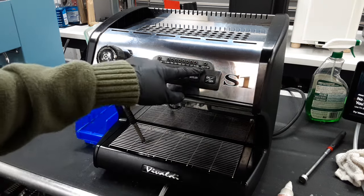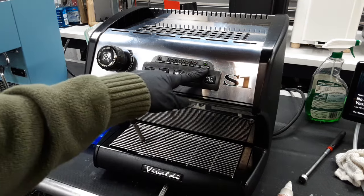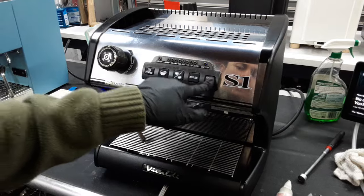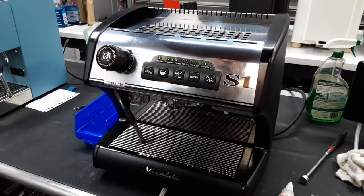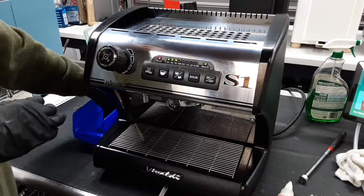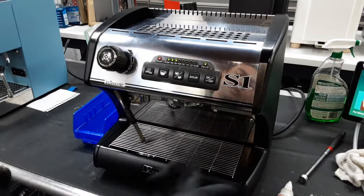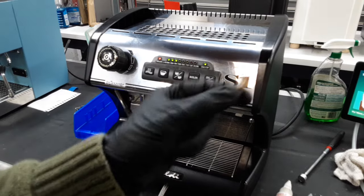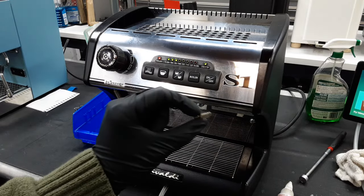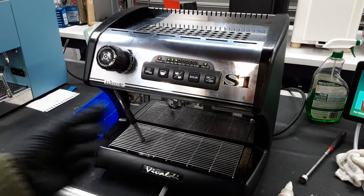This light wasn't flashing at all — indication that there's no power going into the machine, and if you try turning it on, nothing would happen. What had happened was the fuse located on the bottom corner of your machine was broken in half, so it popped. We replaced it with a new fuse and turned it back to life.